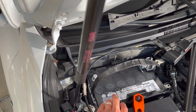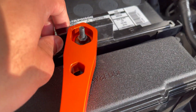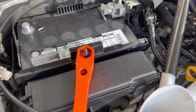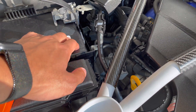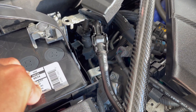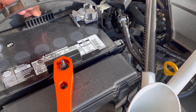This is how the battery sleeve looks — the battery is a great fit, but in order to accommodate for the H6 they install these spacers here. You've got three options: you can lift it up and run it as-is across and bolt down securely — I'm not doing that. You can choose not to run the sleeve at all — the clips shouldn't be too much of a problem the way they're connected. Or option three: cut these spacers off. I'm going to get some snips and make it look as pretty as possible just to maintain the sleeve.